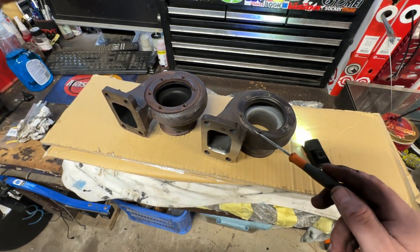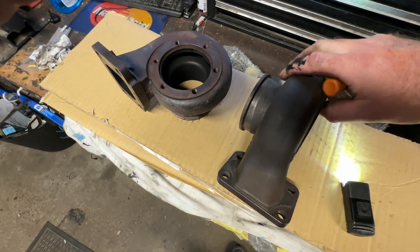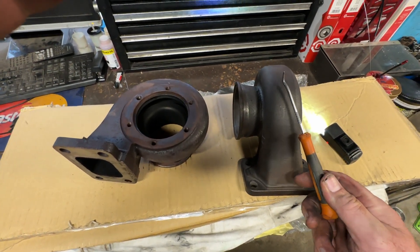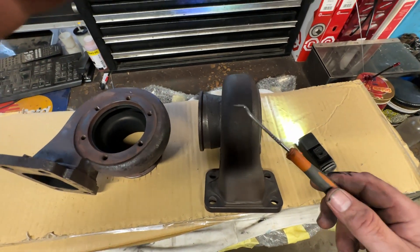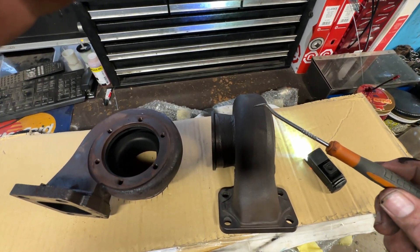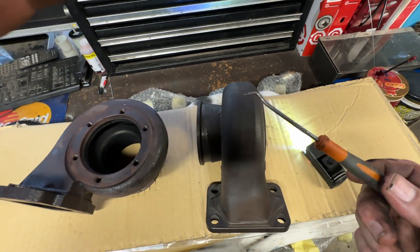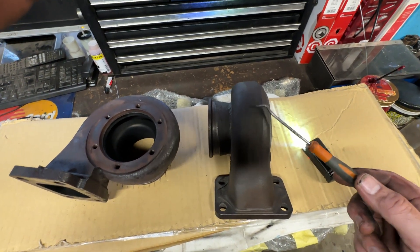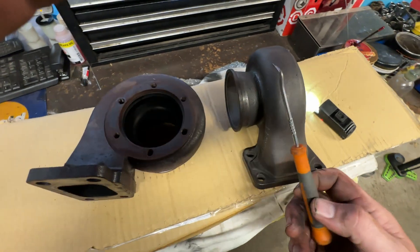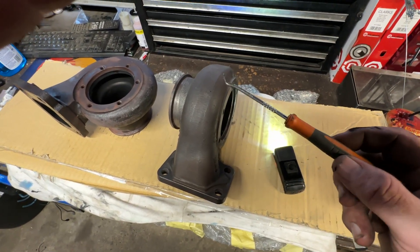Now, the GT3076 is 10-year-old technology. This turbo tech is 10 years old. After that they made the GTX, then the GTX Gen 2, and then the G30 770 is like the more modern version of this. They're very similar on the compressor map up to about 500 horsepower from what I understand. This one has a maximum of like 22 PSI or 450 rear wheel horsepower — they call it a 525 horsepower turbo. This is probably less because it's a 0.63 rear housing. With the most modern one, the G30 770, there are Chinese copies, and I had a guy selling one — he sent me photos of the inside and it actually looks like it has a better designed exhaust housing aerodynamics — a lot better than what this old one is.